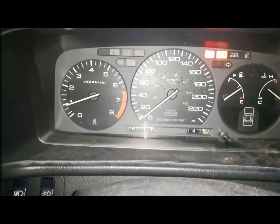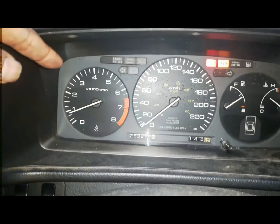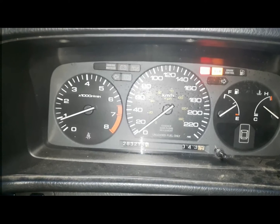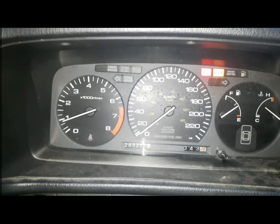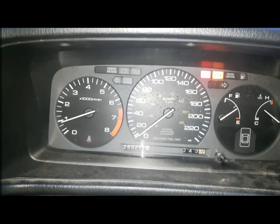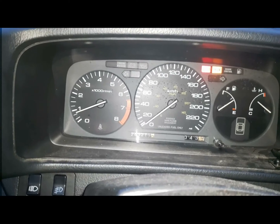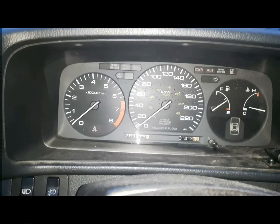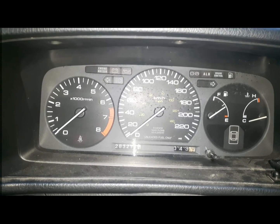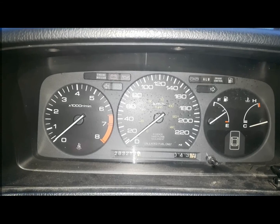So that's it — the car ran beautifully with the fast idle controller deactivated. Before, even in neutral, it would get stuck at 2500–3000 RPM and stay there for a few seconds before dropping. Now it smoothly goes up and down and doesn't get stuck anymore. It's running a lot better. So that's the famous Honda high idle issue — it's not the idle air control valve, it's the fast idle controller. Please share and subscribe — hope this helps, thank you.